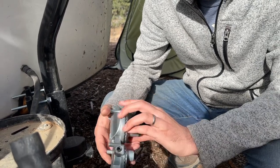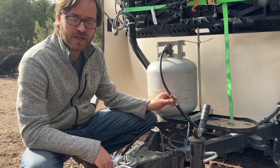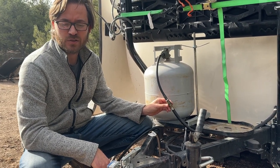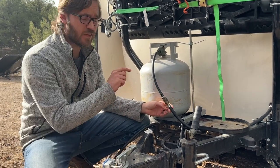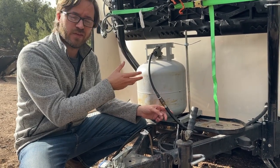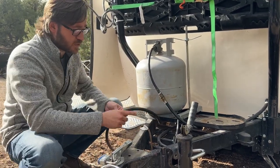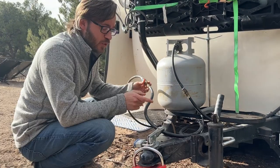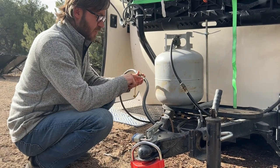This is the 12-inch pigtail, and then that goes into the hose. On the list it's going to be a quarter-inch female NPT to a quarter-inch male NPT, and that'll go into your tee. The tee will go into the regulator, which goes into the rest of the camper, and the other side will be the high-pressure side for this hose. These two hoses are actually the same hose — if you look at the list there's a "times two" — so that quarter-inch hose goes from the tee.